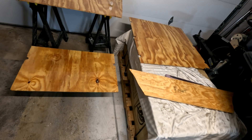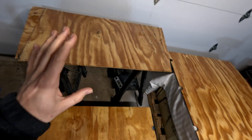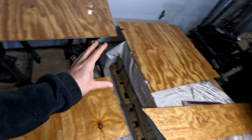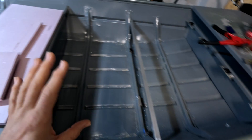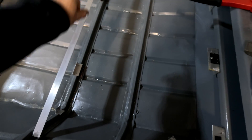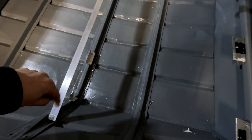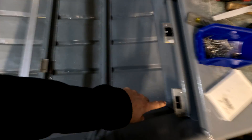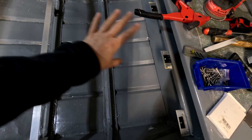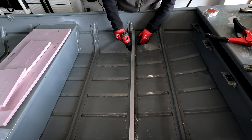We'll check back in the morning. We are back out here the next day and everything is looking absolutely perfect. There's a nice hard shell on each side of the wood now, so we are good to start installing everything into the boat. Before I get everything installed, there are a couple things I need to tidy up in the front area — it's pretty much just throwing in a whole bunch of rivets. I have a couple of brackets along here that need an extra rivet, and I need to throw an extra rivet into all of the hinges to shore everything up. Once all those rivets are in, everything should just install right into place.